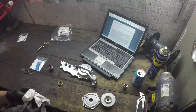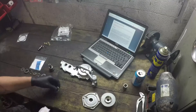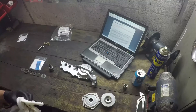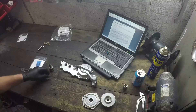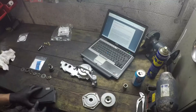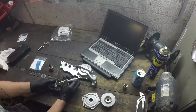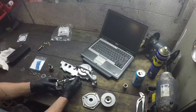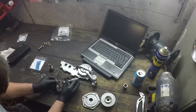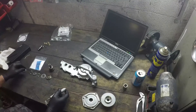I know I'm going to replace the ring but I'm doing that so I can measure it. One of the bearings, a sort of central disc that spins on these bearings, a spacer, and then the final sort of core plug — this is all held together by a left-hand threaded bolt, so we want to go lefty tighty righty loosey. I want to measure that ring's thickness using a mic. We're looking at 7.4 and a half mil — about the same, and the same. So at least it's worn flat, this ring, but it's 7.4 and a half mil.